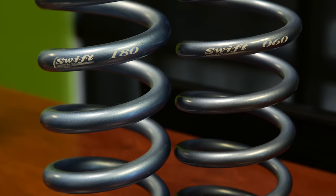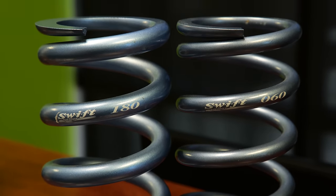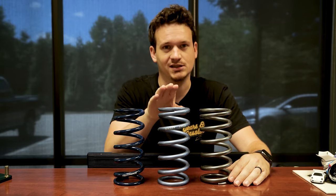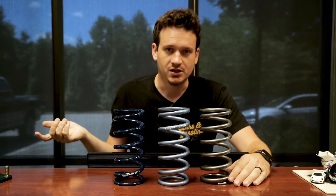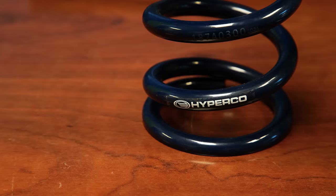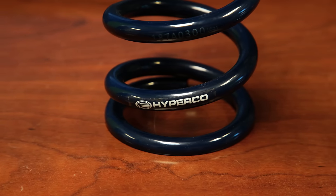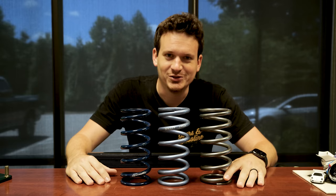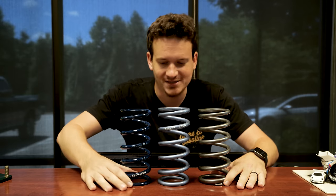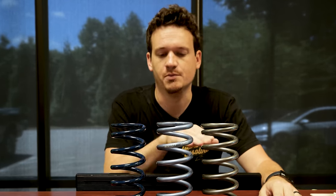I'm going with the Swift for my option. It has a little bit less tightly packed spring coils, which makes it lighter and should give a slightly faster reactionary movement on the coilovers. The Hyperco springs have an F1 background and great name recognition. The Fortune Auto springs look really nice because they're silver. But honestly, the difference between the three is quite minor.